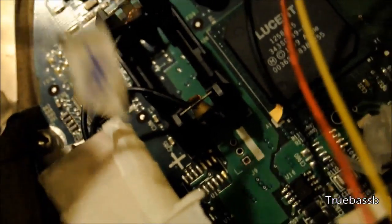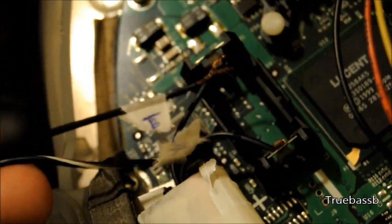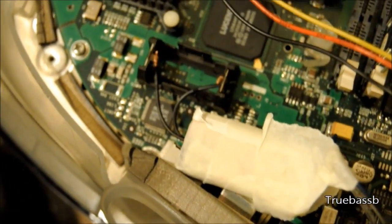Now put the positive wire to the pin on the battery socket with the plus marking on the motherboard, and the other to the other pin. Try to put the correct date and time, unplug the computer for a few seconds, and if you power it up and it still has the correct time, apparently it works.